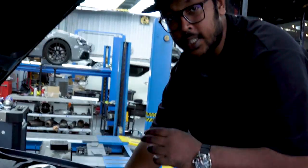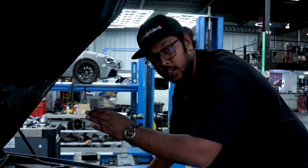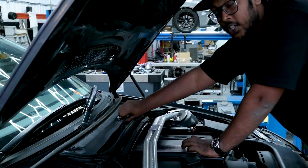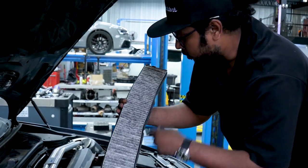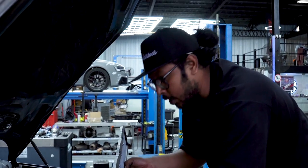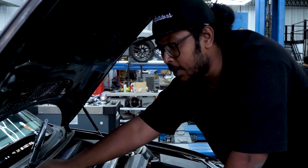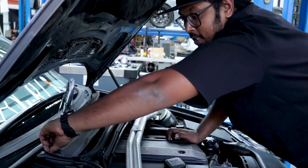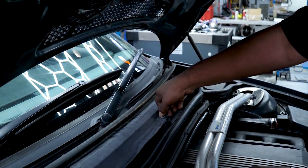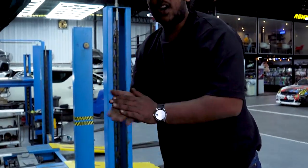As part of basic maintenance, you also typically change the cabin filter. I didn't get one today but the existing charcoal filter looks pretty fine. I'll cover that in the next E46 maintenance video so you can compare old and new. The cabin filter mechanism just twists and locks in — press it in, twist it, done.